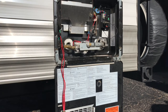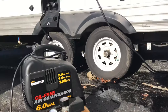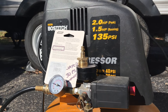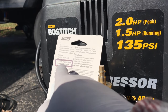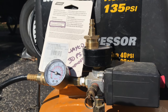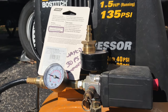Looks like that's done — let's power on our air compressor. A quick note on the Camco blowout plug: they recommend not going above 50 PSI of air pressure, but if you read Jayco's manual, it says to never go above 30 PSI. Set your air compressor to 30 PSI to avoid any problems or voiding your warranty.